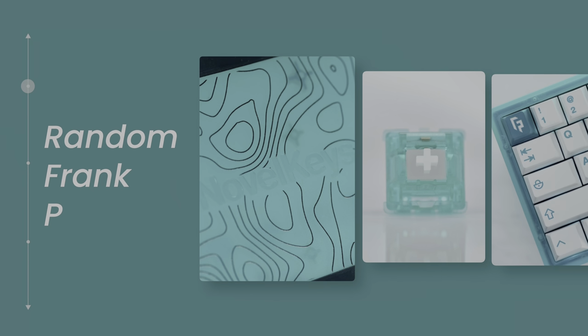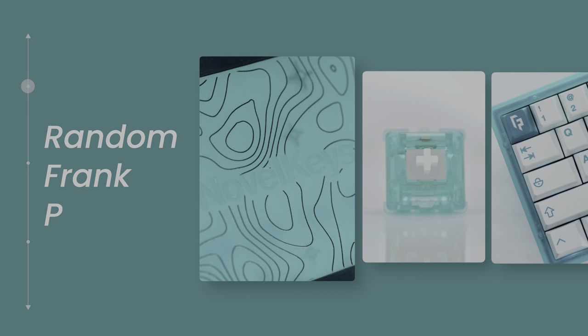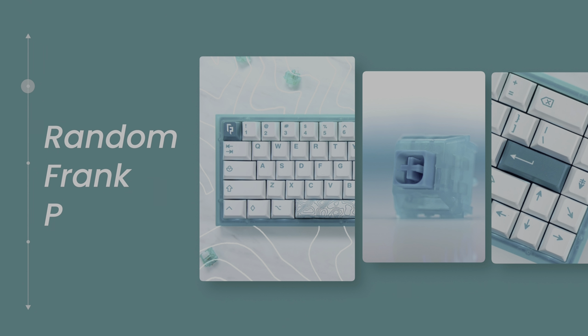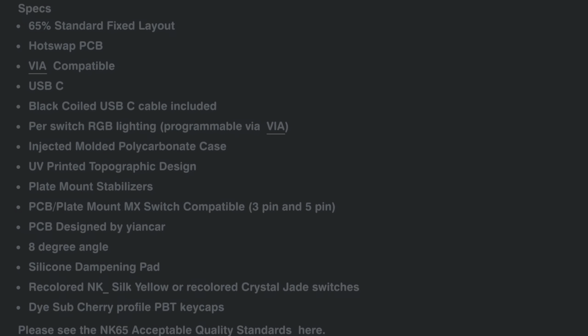Now the RandomFrankP board is going to be a 65% standard fixed layout board and it comes fully assembled with a carrying case. Nice. It's got a hot swap PCB and is VIA compatible and you get a black coiled USB-C cable that comes with it. It features per-switch RGB lighting, an injection-molded polycarbonate case, UV-printed topographic design, plate-mounted stabilizers, a PCB plate-mount MX switch-compatible 3-pin or 5-pin. It's got an 8-degree typing angle and a silicone dampening pad.